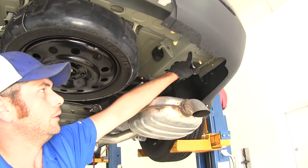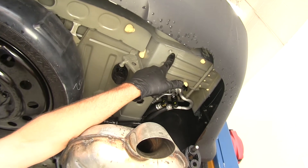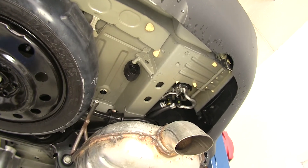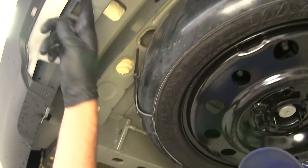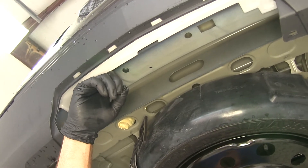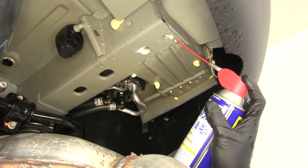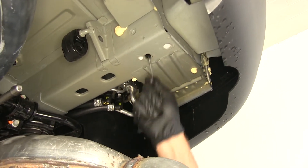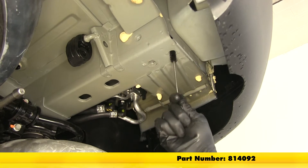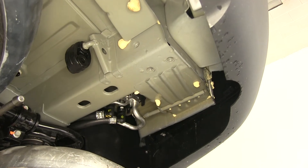That gives us plenty of room to get to the two weld nuts in the rear of the frame — one right here, one right here — which are going to act as our outside attachment points, on both sides. In the middle, you can see the two rounded holes where we're going to put our plate nuts. Before lifting the hitch into position, it's a good idea to use a little spray lubricant and a tube brush to clear out any dirt or debris from those weld nuts. If you don't have a tube brush at home, this one is part number 814092. We'll do that on both sides, then get our hitch put in place.